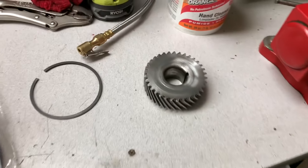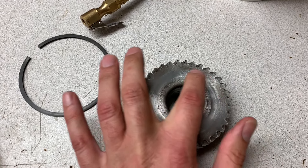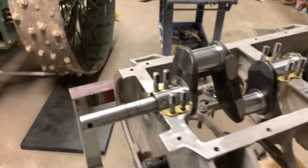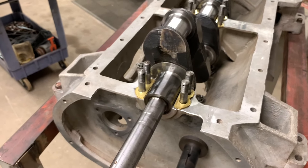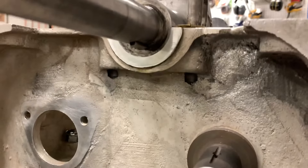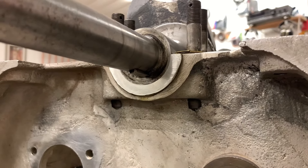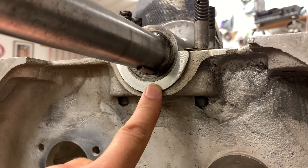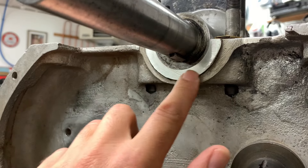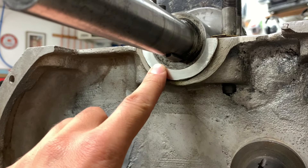One reason why I was really double-checking things: this is the crank gear — that's the front, this is the back. You'll see there's this big witness mark, basically a ring that was wore into it. When this motor was taken apart, the end play was horrendous — you could grab the end of that crank and slop it back and forth. As you put this together it gets a little tricky to drop it into those bearings because that is actually what keeps it positioned. I've got to put that gear back on, and I've got to take it out to do that because I don't want to pound on this with it in — this bearing material is going to take all that thrust from the blows. I was happy to see George did a good job here. The journal stands proud of the bearing material a little bit, so I can take that out, drive it all the way in, drop it in carefully so that none of the teeth hook and grind on that. It should be nice and tight.